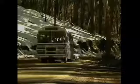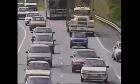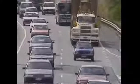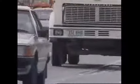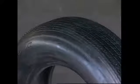However, during cornering, stiff sidewalls can distort the tread and partially lift it off the road surface, which reduces the friction between the road and the tire. Stiff sidewalls can also make a tire run at a high temperature, because as the tire rotates the cords and the plies flex over each other, causing friction and heat. And a tire that overheats can wear prematurely.